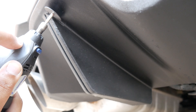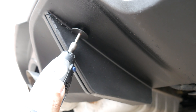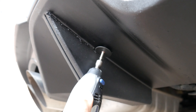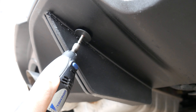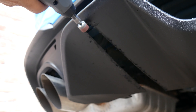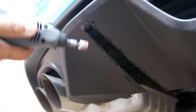Using a low to medium speed, cut out the OEM fins, cutting along the inside where the fin meets the valance. Cut along the length of the fin from the bottom to the top on each side of the fin. Make the final cut across the top to remove the OEM fin. Then deburr the edges of the cuts so the RTR Rear Diffuser will sit flat against the surface.